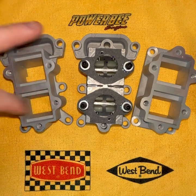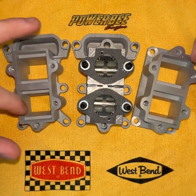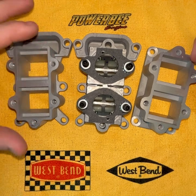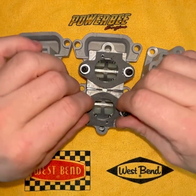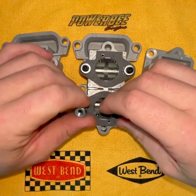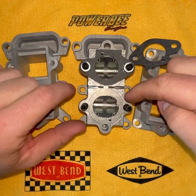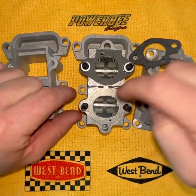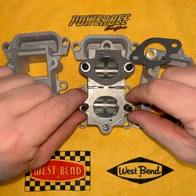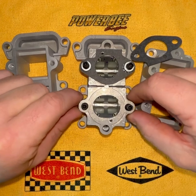This is based off of a K-Lab intake. I liked it because it had both reed cages horizontally oriented, versus some GEM ones where one is horizontal and one is vertical. What I don't like about that is you have to turn your reed cage — you can see there's a little indent right there — and drill a new pulse hole fitting.